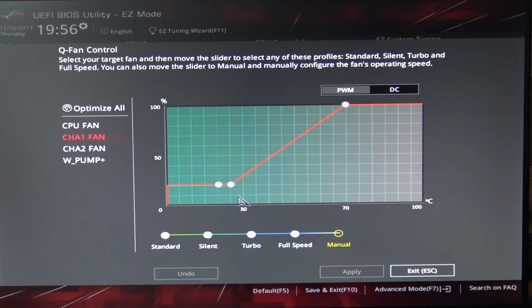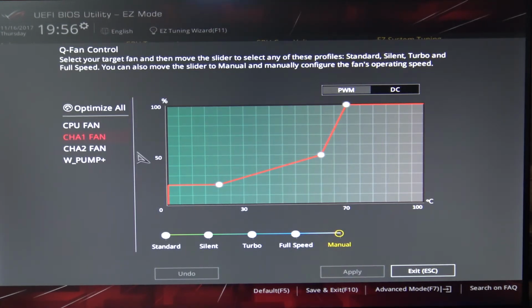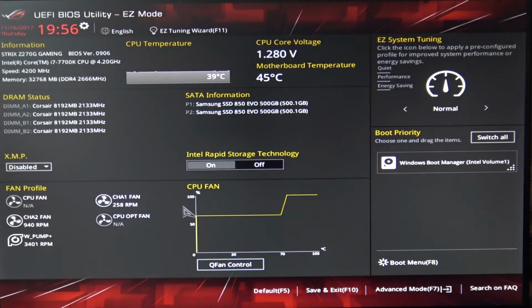So assuming that your goal is to achieve the most quiet operation possible, you're going to want to go into your fan settings and set that to the most silent profile that you possibly can. And certain motherboards are going to restrict the way that your fan curves are set up. They're not going to want things to get too hot, so they're going to kind of force the curve to ramp up over a certain temperature. However, if your loop is properly configured and you have enough radiator space, you should never really be coming close to that unsafe temperature range anyway.